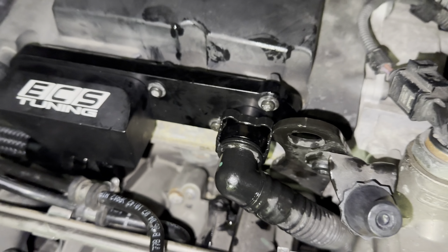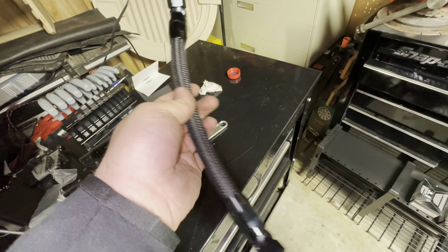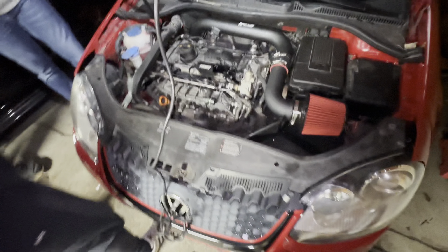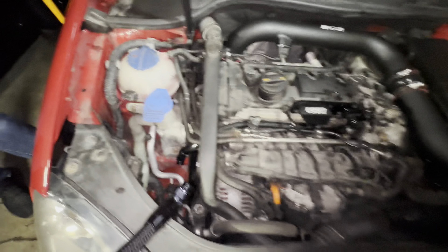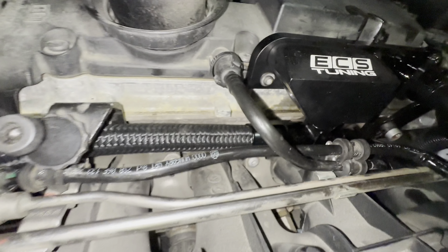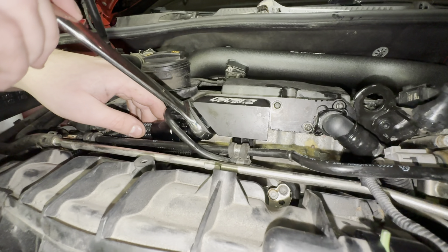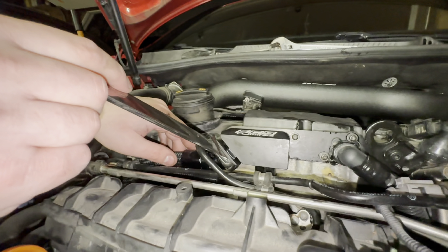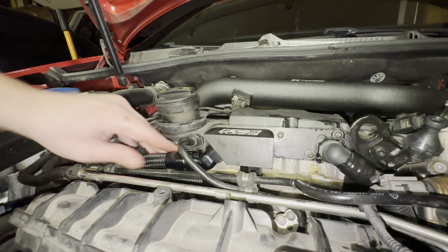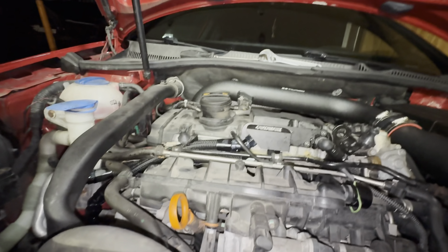It's because there's a lot more space for the feed line and the return line to fit through here and be routed to where the catch can is going to sit. Best way to put it through is kind of push on this a little bit and you can just put it through. Then you're going to put it underneath the fuel lines. Use your bolts — give them to my lovely assistant. Make sure your gaskets are in good condition, which they are. Just kind of don't go too tight so you strip it. You want to evenly distribute it because you've got the gaskets.